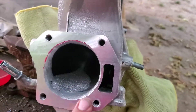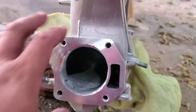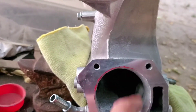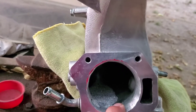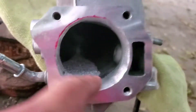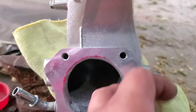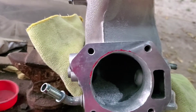We'll measure this to see what the inlet is. I forgot to measure it on camera, but I measured it last night when I took off the screws and it's 65 millimeters. Surprisingly, this is already 65, so we'll see what we max this one out to. I have my other ones maxed out to 70, but I think that may be giving me some issues. I'm gonna leave that little nipple on there because I don't have a 70 millimeter throttle body and I need to be tuned, so I'm gonna make this one to the J35 spec and smooth it out as much as possible with sandpaper.